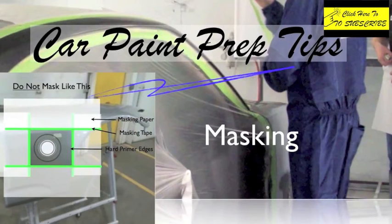Now we're going to talk about masking, and in this photo you see where it's masked off square like that. That's something that you don't want to do, is make a really hard edge around your repair area. And the reason this is done is to keep your primer area small.